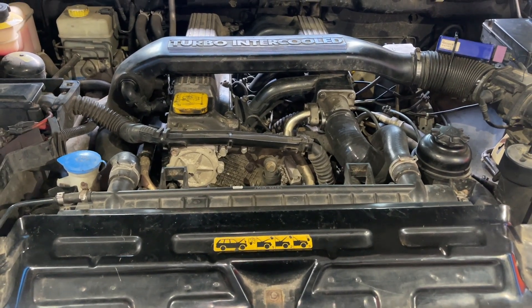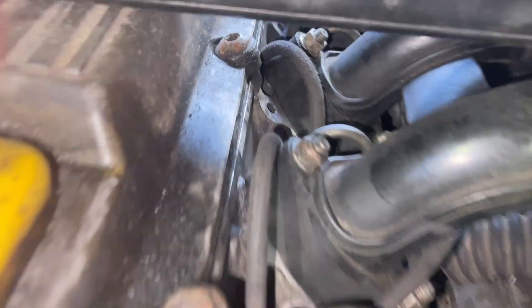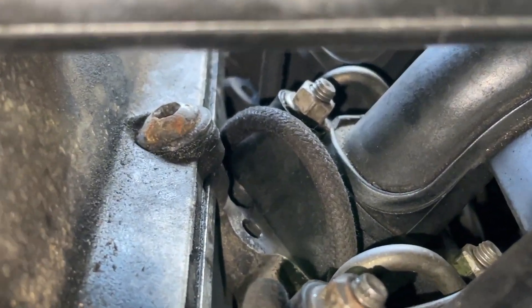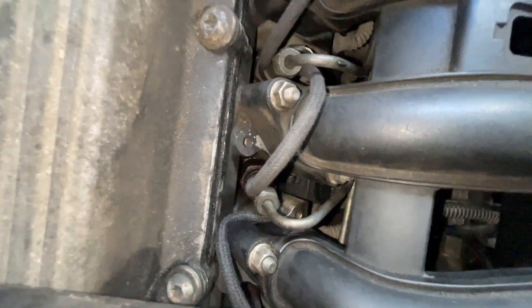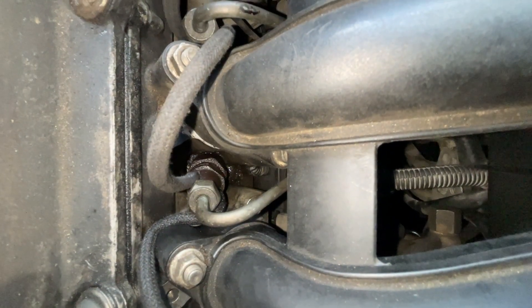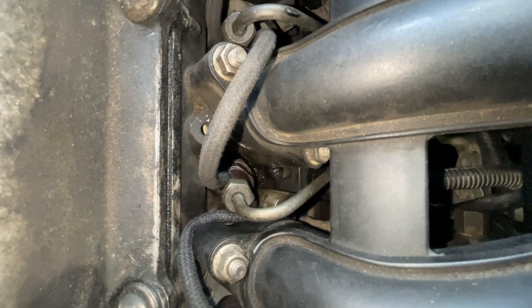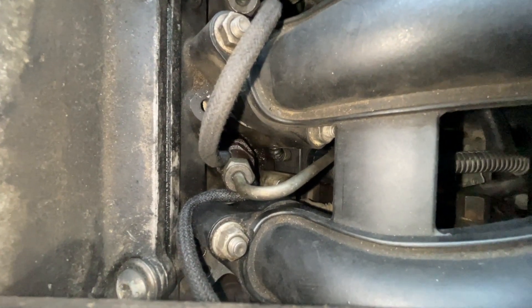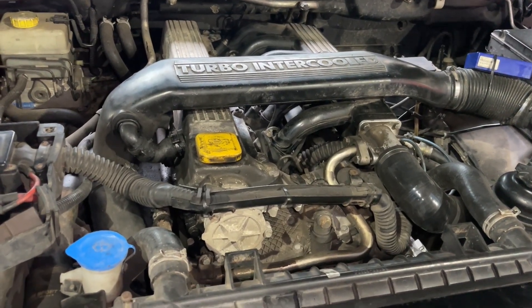I've just been for a little run up the road; it stunk of fuel. Having another look, it's still leaking, but I think I've found why — I trapped the leak-off pipes under the inlet manifold as I did it up. It was pouring fuel out of one of the injectors as you can see. This needs to be undone and a new bit of pipe put in. That's changed now but there is still fuel leaking.